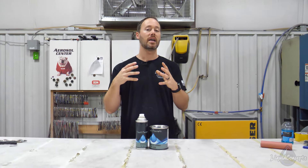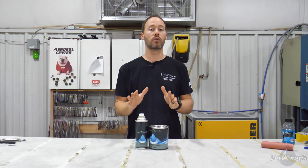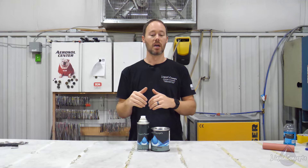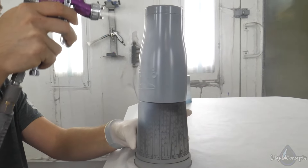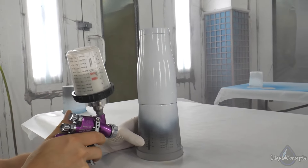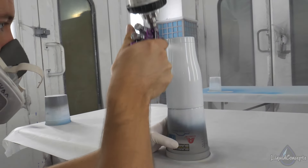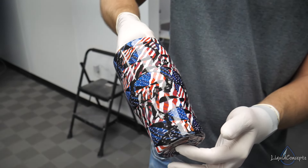The nice thing about mixing this as a sealer is that it is a little bit slower drying, but if you spray it and everything sprays out slick and smooth — which it should — then you can mix up your base coat with no need to sand, no need to do anything. You're saving a lot more time between the primer and the base coat. You can spray your base coat directly over this primer, and as it dries it stays open, locks the base coat in, and you end up with a much stronger coating overall — especially when doing hydrographics.